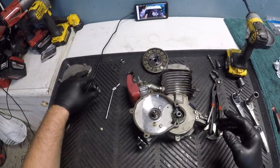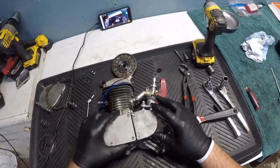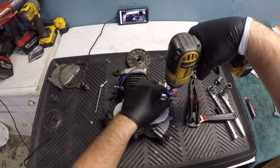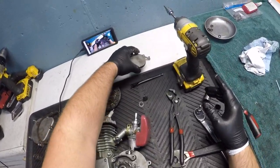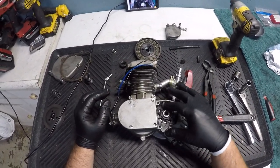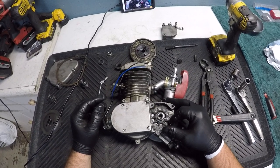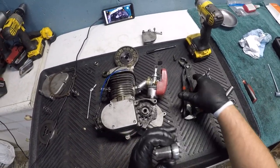While I'm at it, let me show you guys how to get the drive sprocket off — it's very similar. I'm going to use the impact to take the cover off. I don't recommend using an impact like I am if you're not familiar with these bikes, because you can strip out all these threads very easily. You've got your drive gear right here — this is a 19 millimeter — and you're going to have to hold it with pliers.